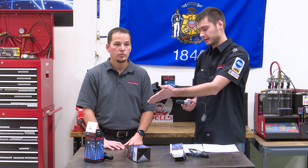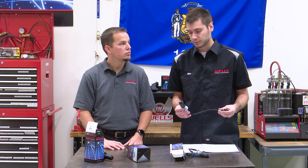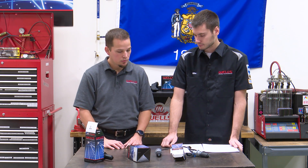Most of the newer vehicles are running that updated design as well, because it's not affected by temperature. To sum it up: if you're running into cold climate issues where your front axles aren't engaging and your four-wheel drive's not working in cold climates, and you still have one of the older aluminum thermally activated designs under there, you can install the electronic motor design as an upgrade, and that should take care of all your cold climate problems and bring your four-wheel drive back to functioning as normal. But the original part is still purchasable and replaceable — it just has issues in cold weather and the engagement may be a little delayed. Thanks for joining us again in the Wells Tech Garage, and we'll see you guys next time.